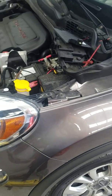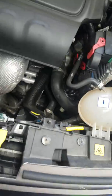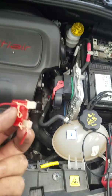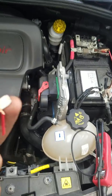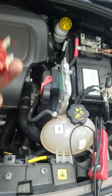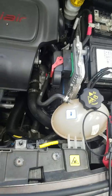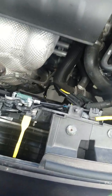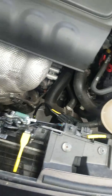This Fiat has a problem with the cooling fan - it had a blown fuse number seven, which is a big maxi fuse. I made my own test fuse, put it in, and it blew again. The fan is disconnected right now. I'm going to put the fuse in and clear the codes so the computer can turn the fan on. If it blows a fuse again, we know there's a problem in the fuse box or wiring. The fan is definitely bad because when you put power to it, it vibrates really badly.